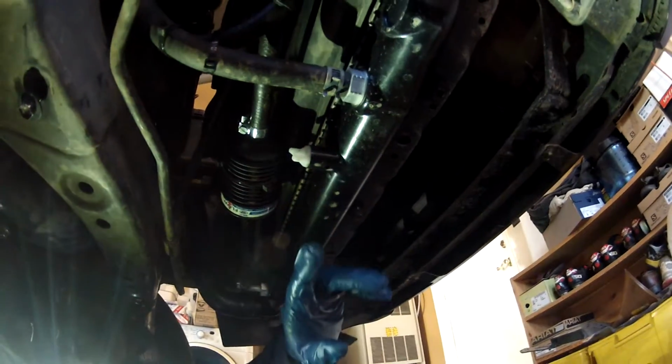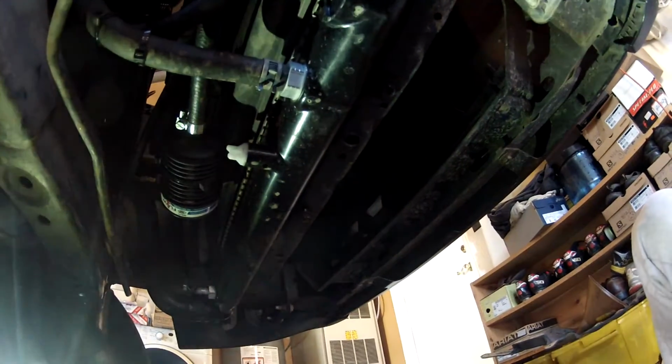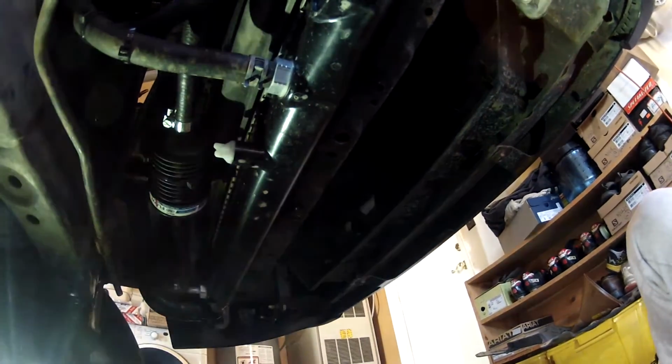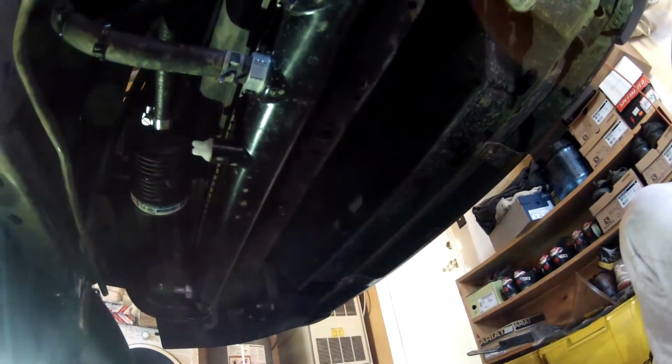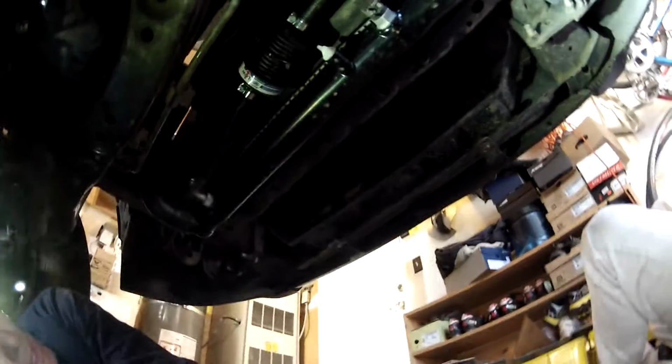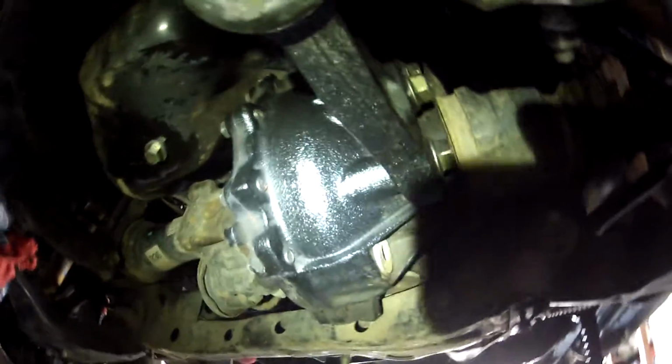You'll usually drain out about 2 gallons, and then you close it, and then you open up your radiator cap and you refill, and then check it after it's been warmed up. And then also in that video I explain how to take out the reservoir and drain the reservoir. So if you look at that video for installing the external transmission cooler, you'll know how to drain and refill the coolant. Next thing we're going to do is drain and fill the front differential.